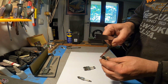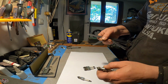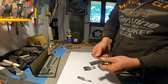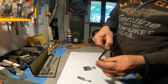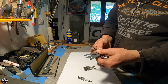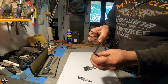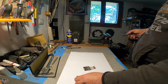This is a little bit off. This side is good. Let's see this one. How off is this? Okay, let's go to the next. That was 0.7, 0.75, 0.75, 0.85. Okay, so 0.85 doesn't go in, so that means this is 0.8. So we're good.